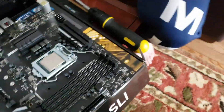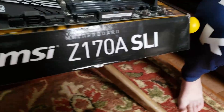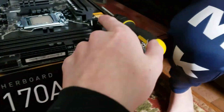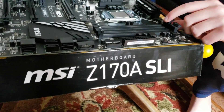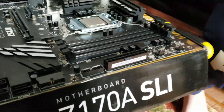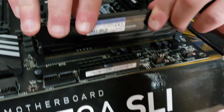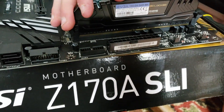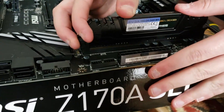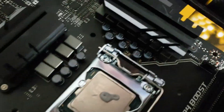Now we're going to get it into here. Why don't you install the RAM stick? So to install the RAM, you have to open those RAM tabs — they should be outwards. They were already open. There's a little notch in the RAM that lines up with the notch in the slot. Put it into the slot and then push firmly with both hands straight down on top. You should just get a satisfying snap. Perfect, you did it!